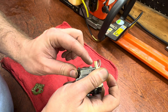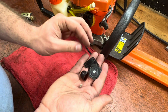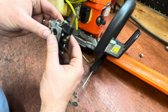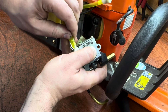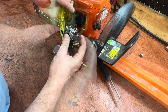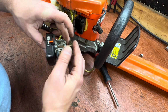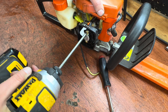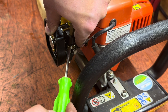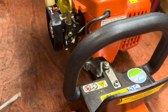Making sure air comes out of that. This is your return line and this is your fuel line coming from the fuel filter. We can go ahead and put this on now. Here are the parts we replaced — let's get those out of the way. This goes on in this direction — this is our fuel line, our return line, and this guy goes up underneath. The choke-side goes up and this gasket goes like this. Slide those guys in and get them started. Now our throttle cable comes down on top, so we have to line up the little fitting — there we go.